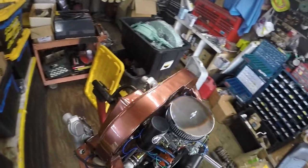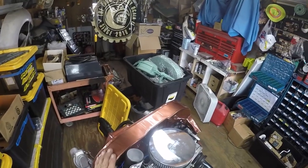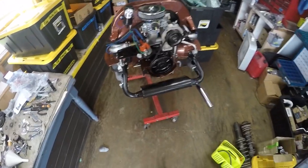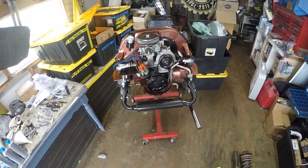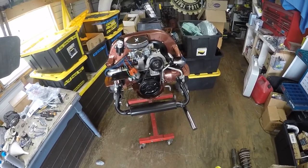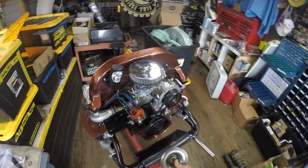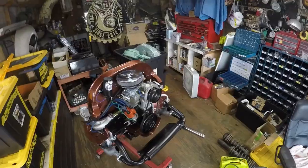The coil is temporarily placed because the AC compressor is most definitely going to be hitting it — it'll likely get mounted here or on the firewall, but I also have the fuel pump to mount, so there's not a lot of room. I took all the fuel injector and emissions-related wiring, wrapped it up, and stored it in the corner of the firewall just in case somebody wants to put it back. I do have the pulley for the AC which I'll put on later after I detail everything out.